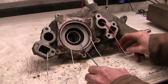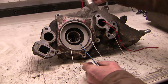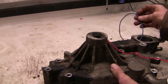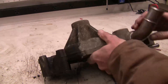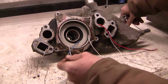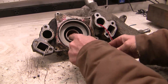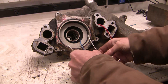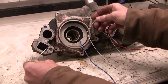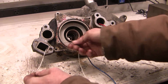The design of this pump seems complicated, but yet it's elegantly simple. I've put some strings to show you which way fluid flows. We start with the radiator return hose — this is cool water coming from the radiator, coming in here. It follows the blue string to there, and from there coolant is flung outward by the impeller to this area. From here, coolant follows the white strings to the engine, cooling the engine off.